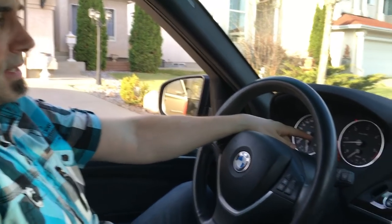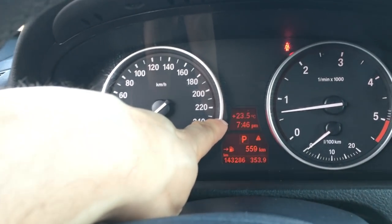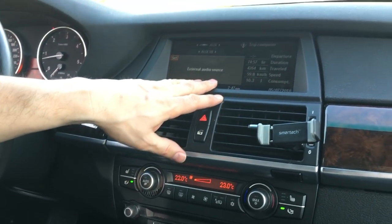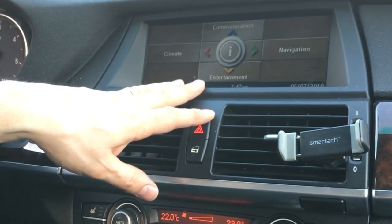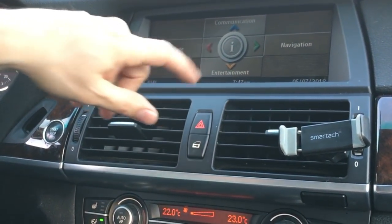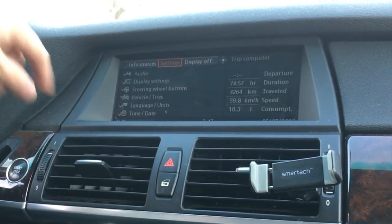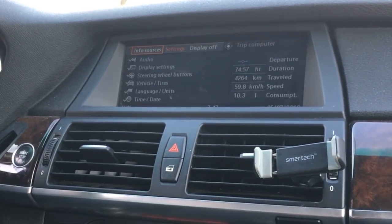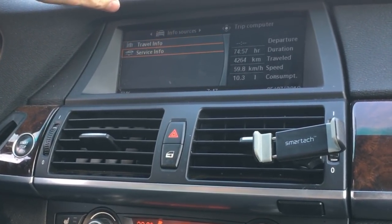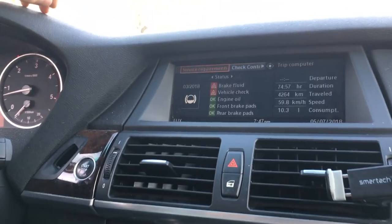So if you look over here guys, right here, that's my indicator — you obviously have a service code light issue here. So we're going to go over to the iDrive screen or the xDrive screen. What I'm going to do is exit out, hit the menu, now I'm in the main screen. I'm going to push that down, and now I'm into these menus. Info sources — let's enter info sources. Now we scroll and go into service info, and this is how I find out where my issues are.